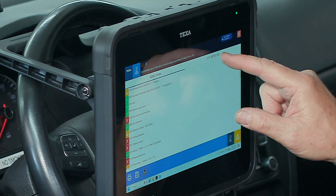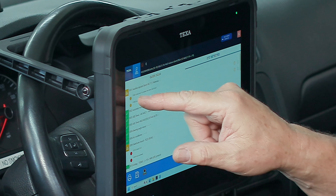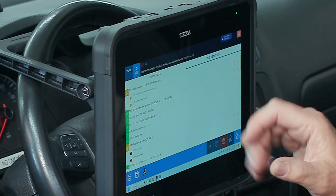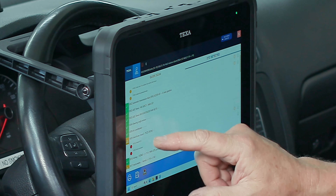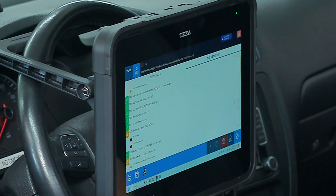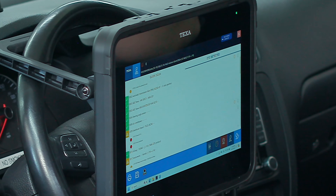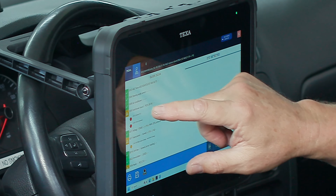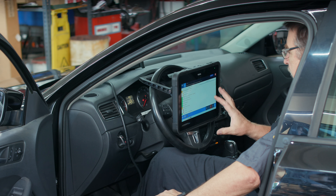You can look at the quick scan and then over on the DTC detected tab, you can get a full report. We've got P1945 — control unit one, radiator fan control short circuit — and P1950, coolant fan jammed or locked fault. We've got a switchover board issue on the BCM, a sunroof issue — yes, this one definitely has a sunroof, we had to disable it, it's one of our loaner vehicles — and an instrumentation fault. There's a lot of really interesting things here.